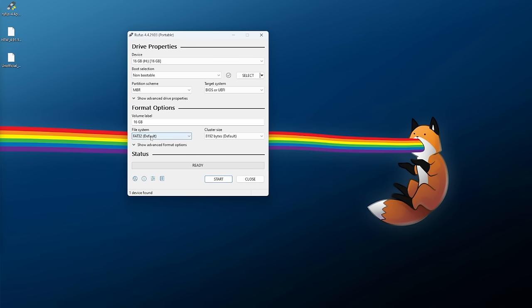Once formatting is complete, click Close. You can right-click the drive, go to Properties and confirm the file system shows FAT32. Now go into your USB drive and create a new folder called PS3 — all uppercase, all one word. Inside the PS3 folder, create another new folder called UPDATE — all uppercase, all one word. Inside the Update folder, copy and paste your HFW file.